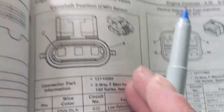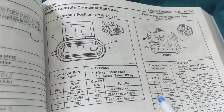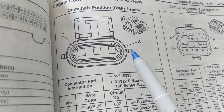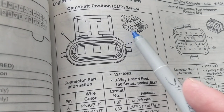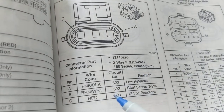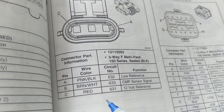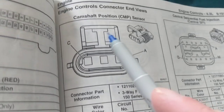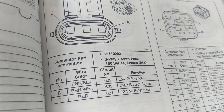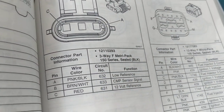Even though I'm looking for the crankshaft sensor — that's where the code is from the scanner — that's okay, that's how you learn. In this graph or pictorial, it tells you there are three connections, as should be for a camshaft position sensor. It shows you the view and what type of connector it is. The black indicates this is a black connector. The connector has three pins: A, B, and C. Let's say I need the voltage — I want to make sure this camshaft position sensor has the proper voltage going to it.